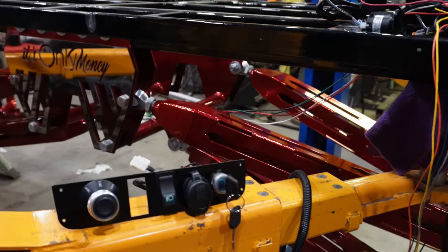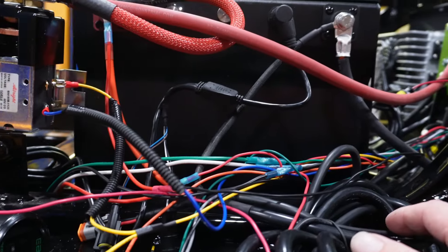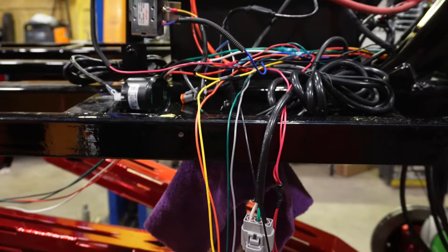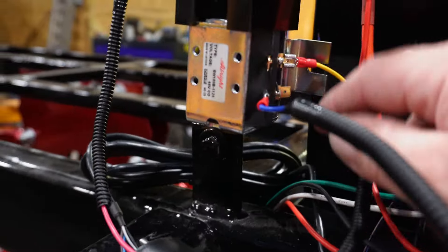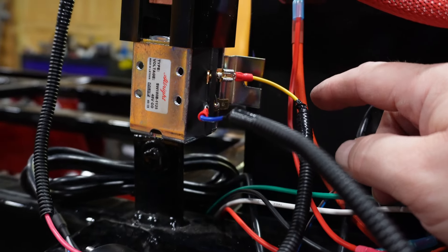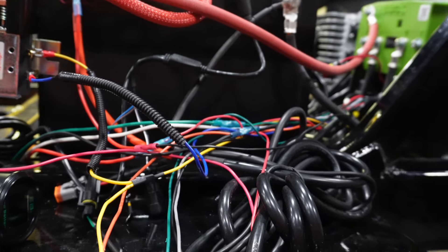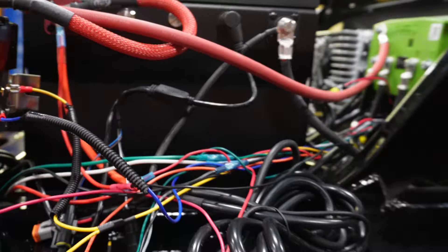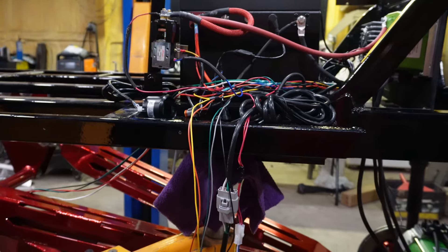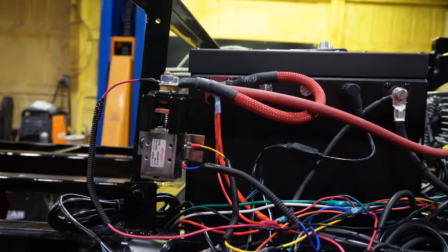It's been several hours. We had everything hooked up — key switch, forward/reverse — and we were scratching our heads pretty bad. Not quite sure what was going on. Going over things and over things, looking at wiring diagrams. Finally got Navitas tech support on the line and they determined — I'm going to blame this on myself — I had the blue and the yellow on the same pole. I've never used this kind of solenoid, and they said that back-fed it and shorted something out in the controller. That is 100% my fault. I feel bad for Charles because he's trying to get this thing going and we've been wasting a lot of time. But Navitas is great — they're a great company. They're going to either refurbish this one or send another one out so we can get this thing going. Unfortunately, that's going to do it for this video. I was hoping to see the thing turn here on the hoist, but that's as far as we're going to get. Stay tuned, we'll see what happens. Appreciate you all coming along.